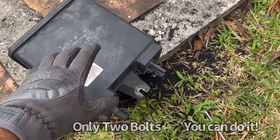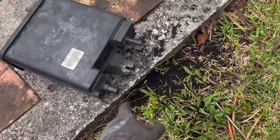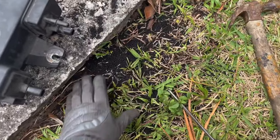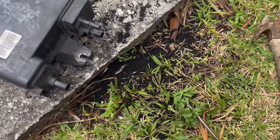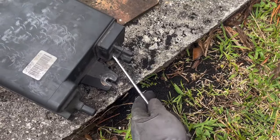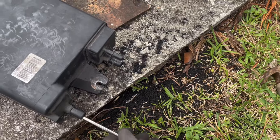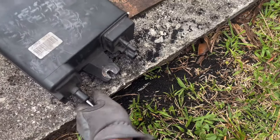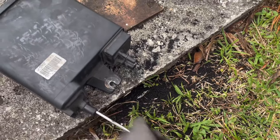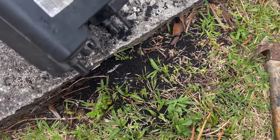So what I'm doing now, purely an experiment — you'll get to see the results if I'm successful — is gutting all of the charcoal out of the charcoal canister that could be clogging it up. Basically you want to take a screwdriver, don't touch these ports because you can't go in there. On this one, you just shove the screwdriver in there, dig around, and you'll feel it. The more you dig, the more you can empty pieces of charcoal out.